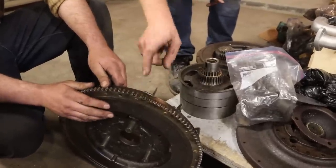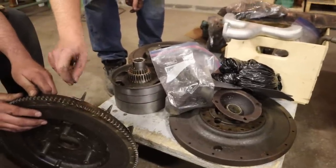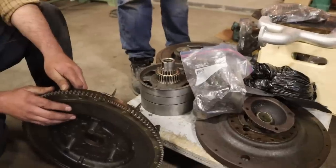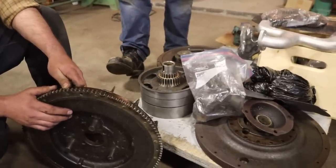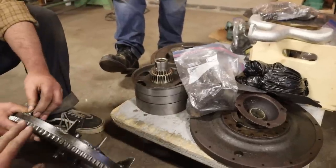Or actually, I just thought of this, what'll probably work, if you center punch it and drill this peening thing, because it's just shouldered into here. Oh, yeah. Then punch it off, and then you can just unthread the stumps. Yeah, Jim's on it. He's an engineer. Okay. Yeah. Trust me, I'm an engineer. But no, that's the best way. Yeah, let's do that. So, and bing, drill.